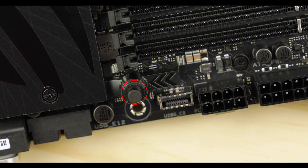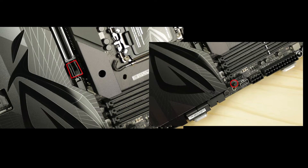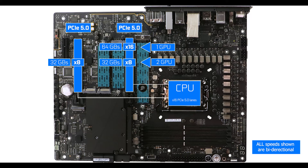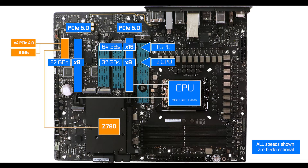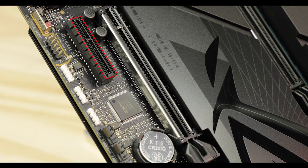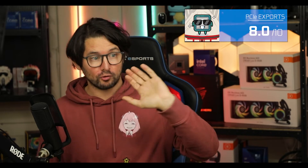Hence the metallic reinforcements on both of these slots. I also want to note the now very famous Asus PCIe release mechanism, which they introduced a couple of years ago and has since been copied by all its competition. The last slot is a dual-slot which can operate at a surprisingly fast x4 PCIe 4.0 standard for a total of 8 GB/s — good enough for PCIe-based M.2 storage solutions, which is a nice bonus. Overall a very fast PCIe solution catering to extreme gamers and GPU-intensive production users alike.